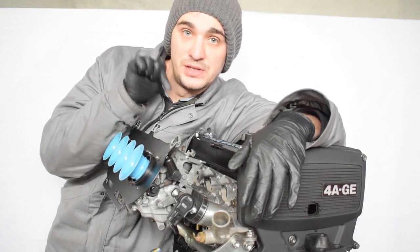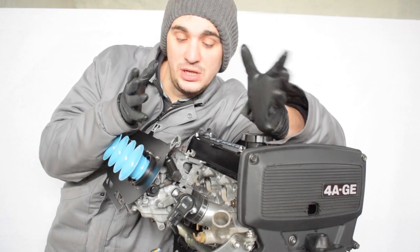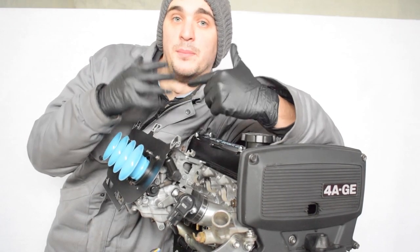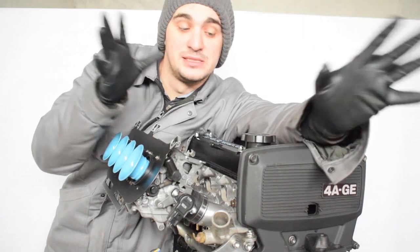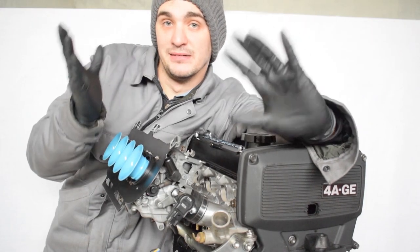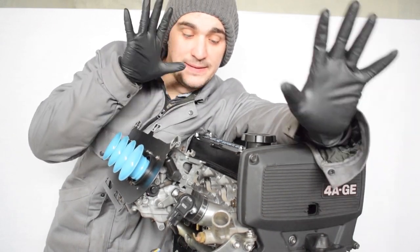Another thing a lot of people asked about is the jetting of the carbs, and yes, the carbs will need to be jetted. I got my kit including the carbs from Dynasty Engineering, and if you buy from there the carbs come pre-jetted — but that's just so you can fire the car up and move it around. To get the most out of the setup the carbs will probably need more jetting. To address that I got a full jet kit from a company called Six Sigma Racing — a very comprehensive kit that includes pretty much everything you need, and there's a link in the description. I'll be using my AEM X-Series wideband gauge to determine whether I'm running lean or rich at all throttle positions, and I'll be replacing jets one by one until I get a perfect setup.